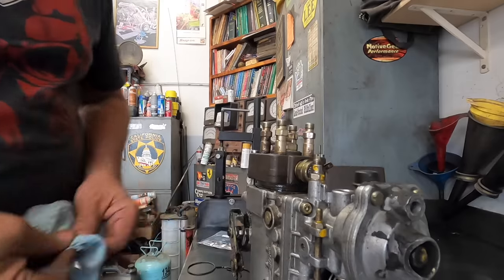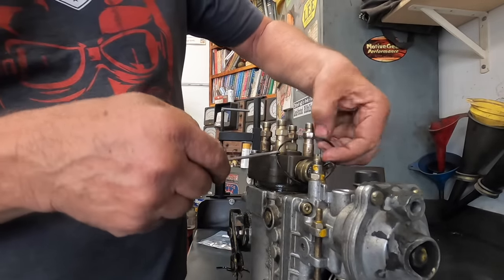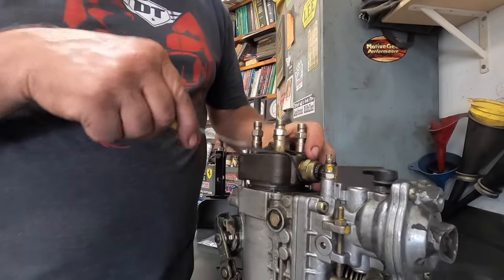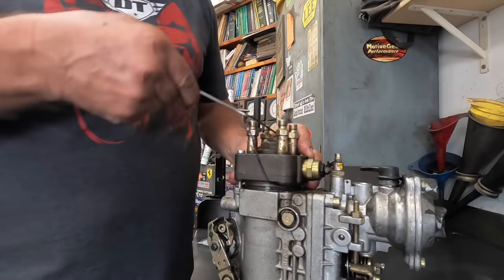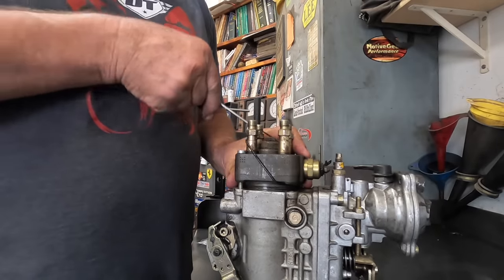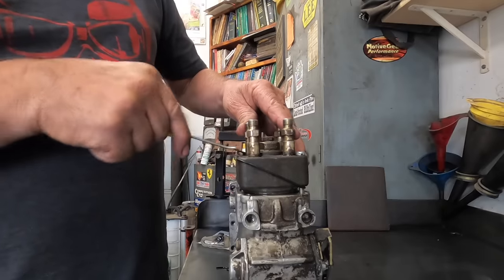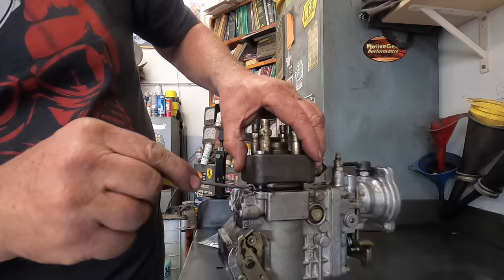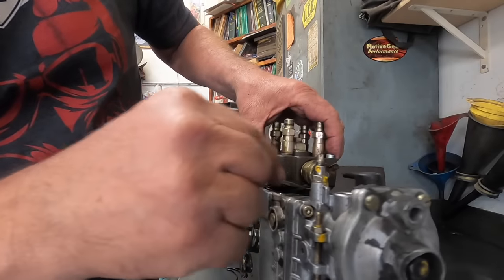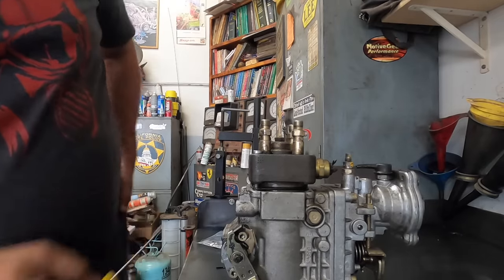And then essentially what you do is you take your new O-ring, you go over that first because that's the hardest thing to get over, and you actually just start working it and stretch it and be very careful. Don't let it clip on any sharp edges. You stretch that O-ring around and then I like to exercise it as much as I can just to get it untwisted. The O-ring snapped in there, but it's up on the bolts.